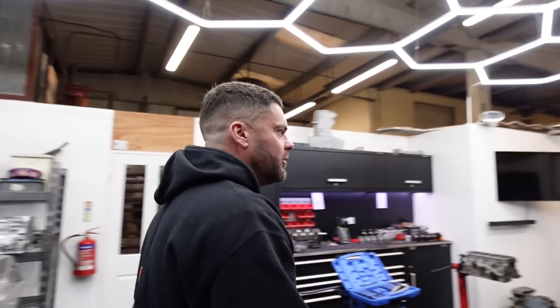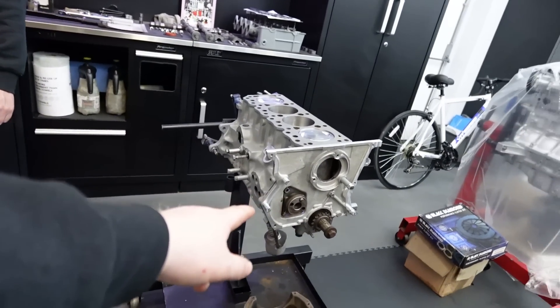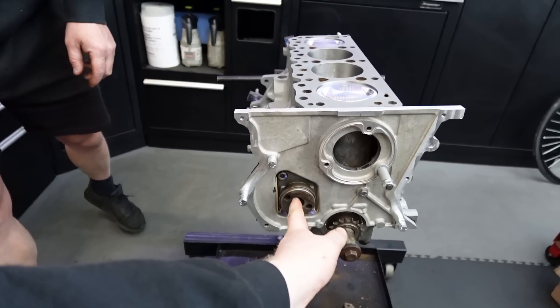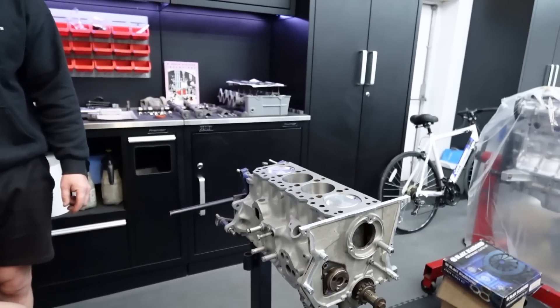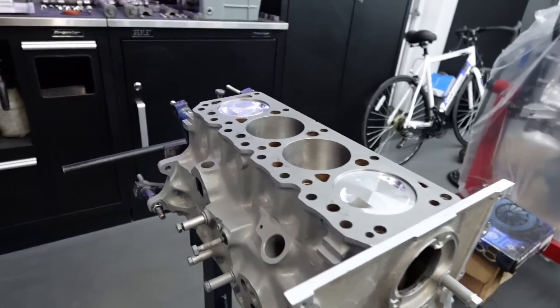If we head over to the computer — it's actually very similar to the setup on the Lotus twin cam, and a few people commented on that. On the Lotus, there's literally just a standard cam from one of those blocks — a Kent block — just sitting in there doing nothing, and the pushrod holes aren't doing anything either. With the BDA they've basically cast the block without the pushrod holes being used. Same sort of thing.